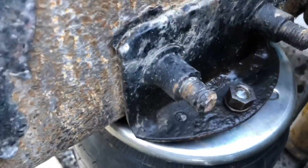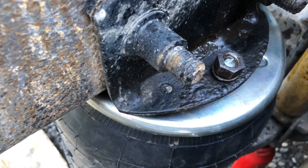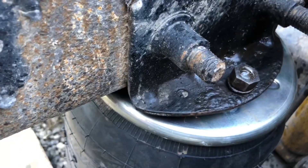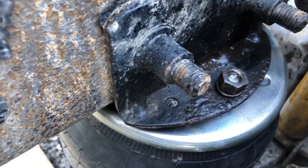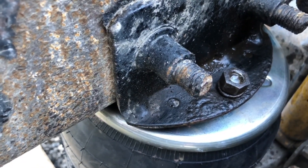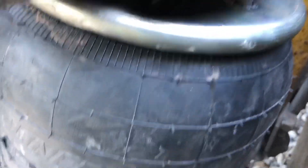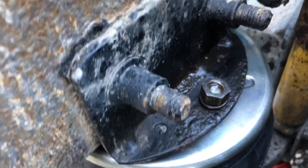I haven't tightened it down yet, but I took the washer and nut and just put a few threads on there to hold it from turning on me. What that's going to do is when I tighten the bottom up first, it's not going to suck this down where it's going to be harder to pull. The stud is long enough right now on the bottom, and after I suck the stud down on the bottom it's going to drop this airbag — but this will hold it up so all I have to do is just impact it from the top. I just started the nut on there.